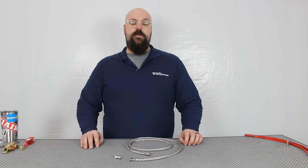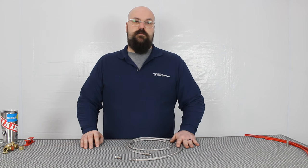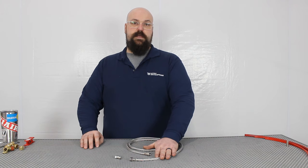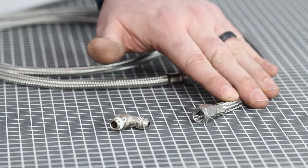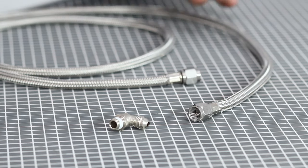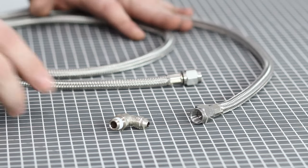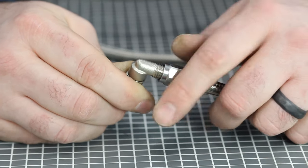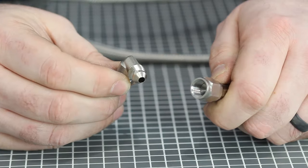Finally, I wanted to show you braided airline. This is only included in Air Lift Load Lifter Ultimate Plus kits or their Ultimate Plus upgrade kit. This is a stainless steel covered braided line which is extremely resistant to abrasion and cuts. These lines cannot be repaired and can't be trimmed, but they do come with AN style fittings which give you unlimited opportunities for connection and disconnection without damaging the line or ruining the seal.